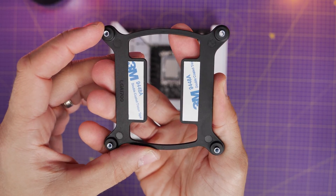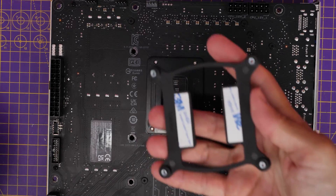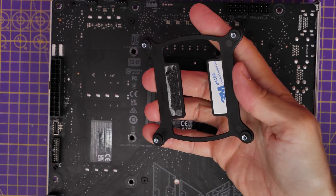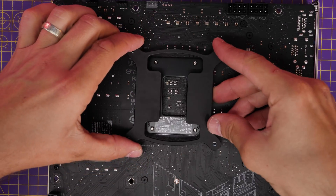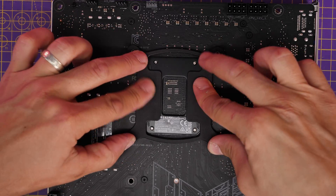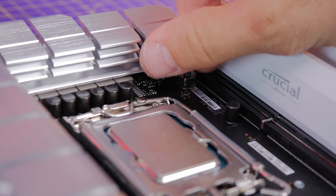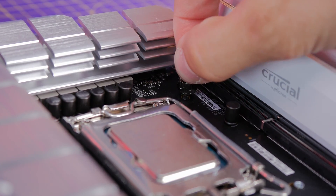Now for the backplate, we need to remove the stickers on the rear and install it on the back of the motherboard. I find this easier to do now than later, though technically you can access the back of the motherboard by removing the SSD tray in this case. You remove the 3M stickers from the rear of the backplate, then it'll stick to the back of the motherboard, and you'll be able to put the standoffs into it on the other side. This is the LGA 1700 socket backplate. Then we use the four standoff screws with the small screw end going into the motherboard through the holes lined up from the backplate, and screw all four standoffs in.